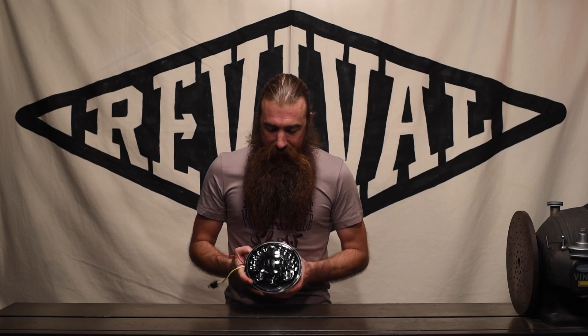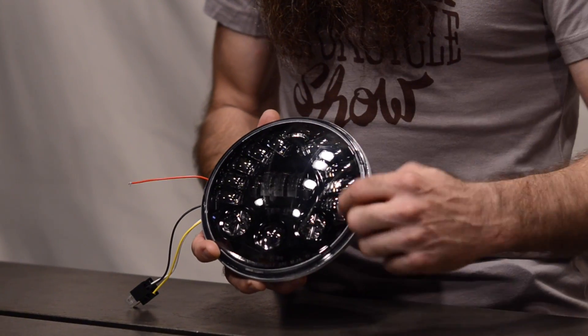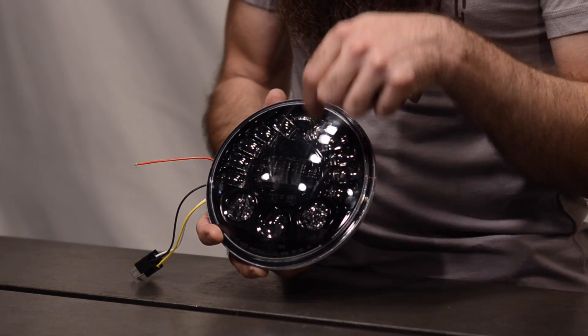Now, when we look at the actual LEDs on this, you can see there's a ton of them. There's a whole string on this side, another string here, the three big ones across the middle, two smaller ones on the outside, another one at the top, and three across the bottom. These all light up in different ways depending on what functions are enabled. Under low beam, we're pretty much just running on the middle three, and during the adaptive phase when you're banking, the sides light up depending on which way you're turning. For high beam, we introduce the three across the bottom.